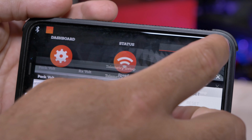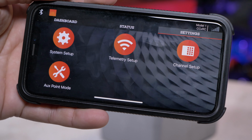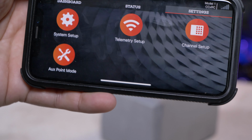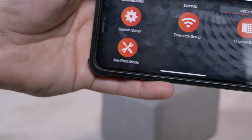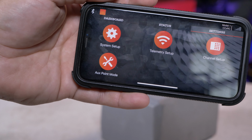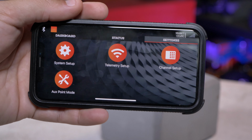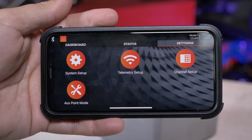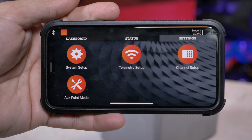I don't know it for the Vortex yet, so we won't be able to get that. The way to do it is you mark the pinion and you count how many times that mark goes around, and you count to 10. On the 10th one where it stops on a ruler, it'd give you the distance that it rolled, and you divide that by the 10 rolls that you did. So if you went 20 inches at 10 rolls, you'd divide that by the 10 rolls that you did, and you'd have a rollout of 2. It's a little bit complex, and the way that the pinion is set up in the Vortex, I can't quickly do it right now for this video, but hopefully they'll have that information for us, because you can also do it using gear ratios, pinions, spur gear, and some other information in order to find that out.